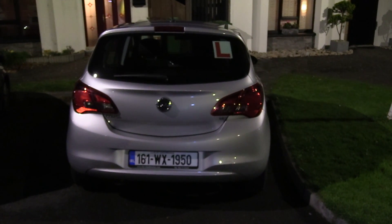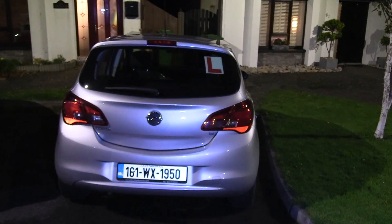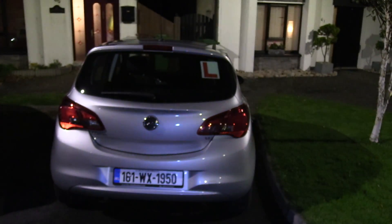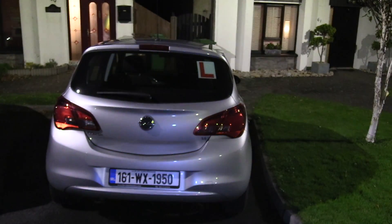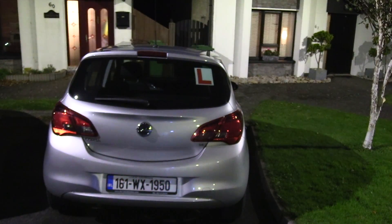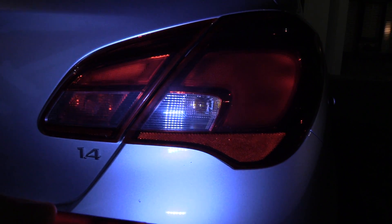This footage is from a few nights ago, testing that the reflectors were working effectively. I'm shining a light from just level or slightly behind the camera, tilting it up and down, and you can see that the reflectors are working perfectly — they're reflecting the light of my torch back at me. That's how you check the reflectors at night: use a flashlight or torch from approximately 5 to 10 meters back, and you'll see them reflecting the light and working properly.